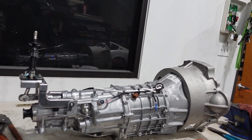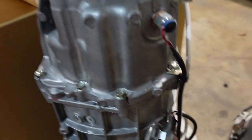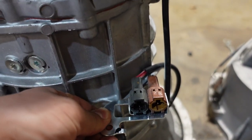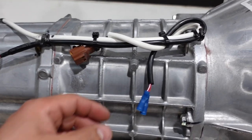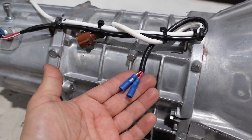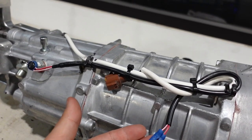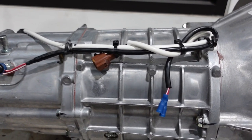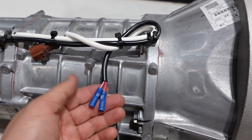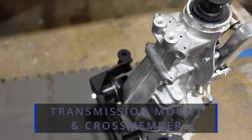Lastly, I want to highlight the reverse lamp switch on the TL70. If you're buying a complete kit from us, we'll convert the harness to plug into your existing Datsun wiring. If you're piecing together your own swap, the transmission will come with two connectors on a small bracket. The brown connector doesn't get utilized, so tie it off and out of the way. The gray one is for the reverse lamp switch — cut the Toyota connector off and crimp female bullet connectors onto it so they'll plug into your Datsun wiring harness. These can be found at any O'Reilly's or AutoZone.